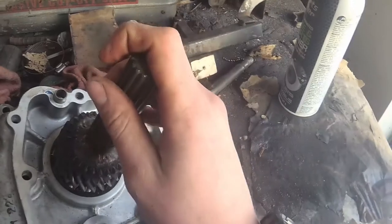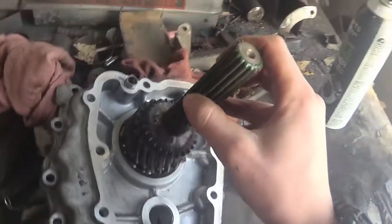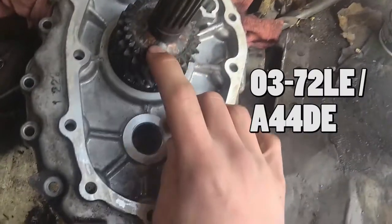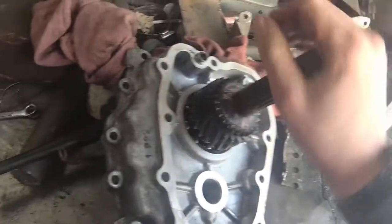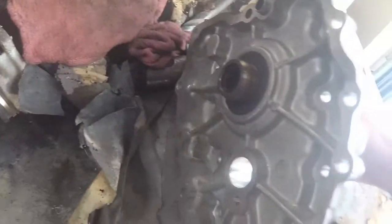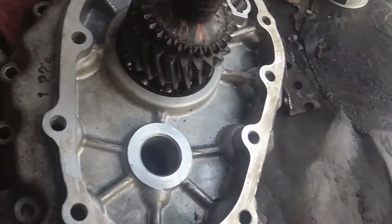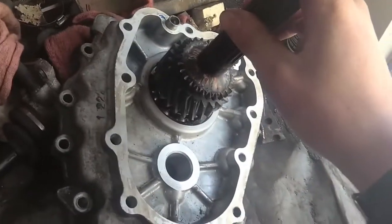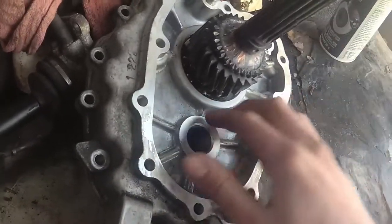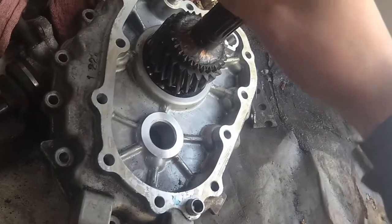I'm going to be replacing the bearing here — you can see it's open. We're going to put a sealed deep groove ball bearing in there, and hopefully it'll handle the elements a little better. It probably won't last as long, but this thing's not going to see many miles anyway — I think it'll be fine. The sealed bearing in there so it doesn't get covered and filled with mud and junk, and we'll be all set. You can see — well it's still hard to see — but they're just pulling on that, and that's why we had to do this: actually support the transmission. It's in park right now so it won't move.